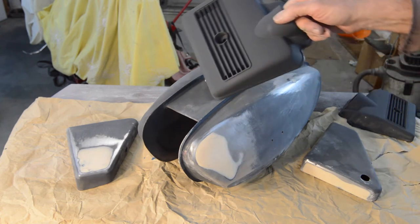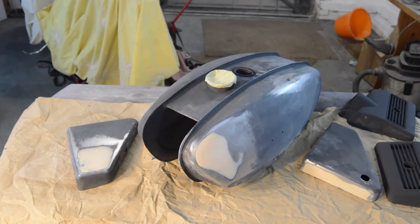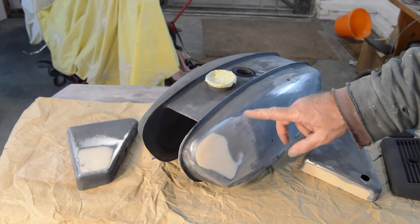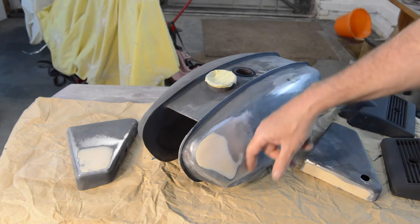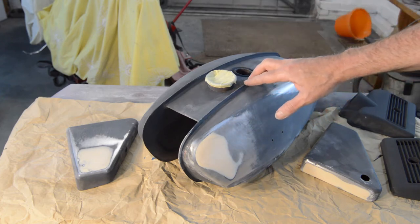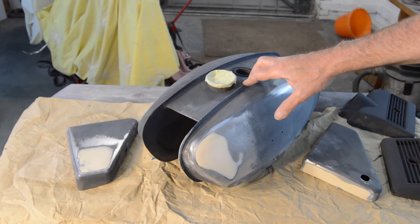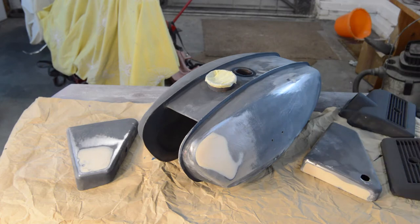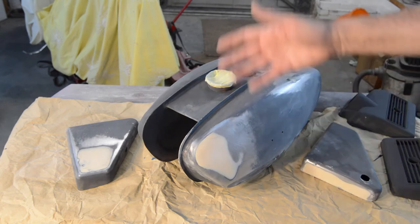The alloy side panels where the air filter fits - both of them are fine and have been etched. You can see the original etched colour compared to the rather dusty version on there now. The next step is to re-etch to get rid of the bare steel from where I've filled it. It will then get two good coats of primer filler, allowed to dry properly overnight, possibly longer. Then I will apply a guide coat. I'm just going to re-etch these with aerosol and then bring you back when it's in primer.